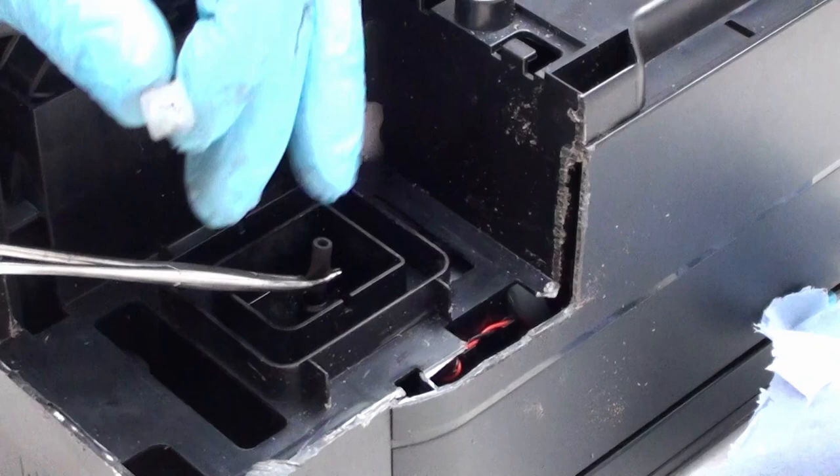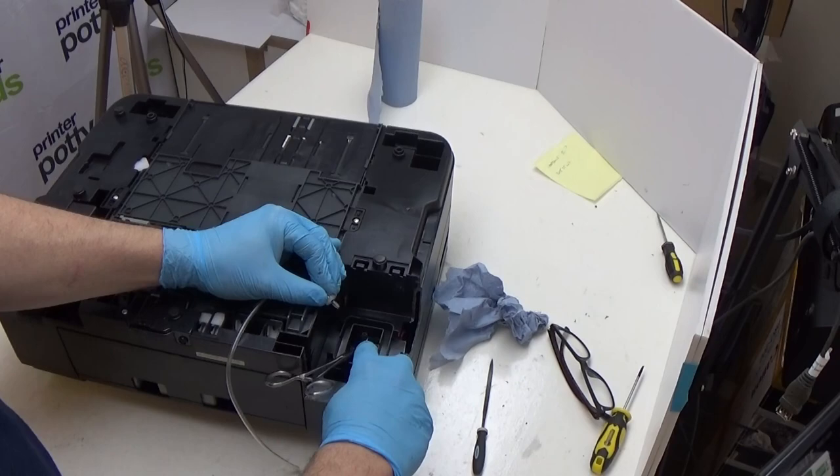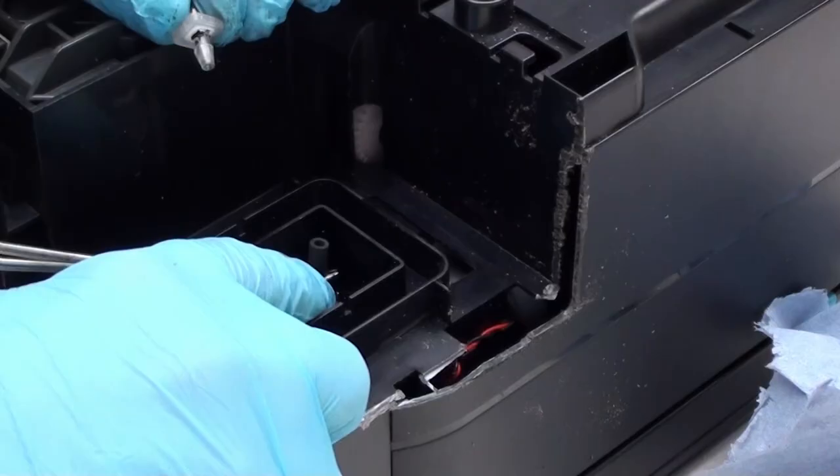The reason you do that is when you come to insert your connector into the tube, you want minimal lubrication on the inside of the tube so that it stays in, and minimal lubrication on the outside of the tube so that the tube doesn't push into the printer and out of sight where you can't get to it.